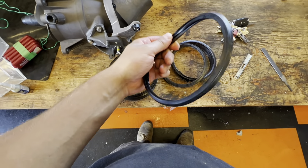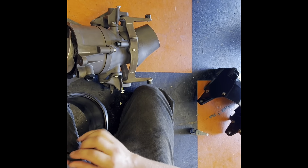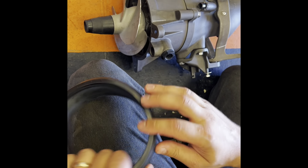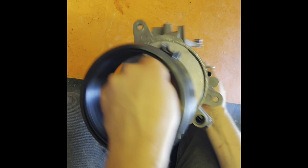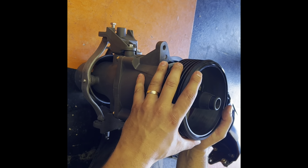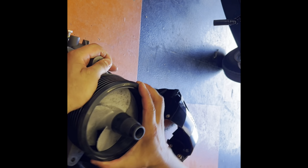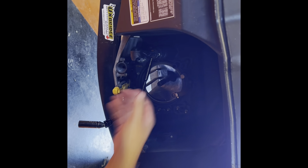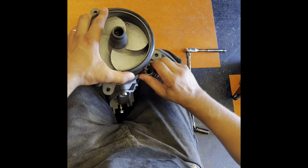This is the new wear ring. I had to peel the gasket off the old one and that gets wrapped around on the new one, so it has to go on there. The gap on these is about five thousandths of an inch, so it's a pretty tight interference fit. One thing you need to do is line up this little groove here — I think it's a cooling intake — so when you put it all together that's what indexes it.